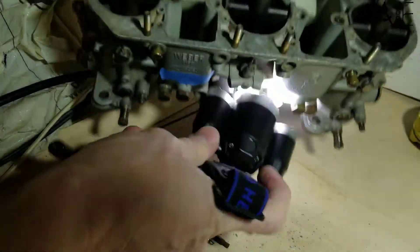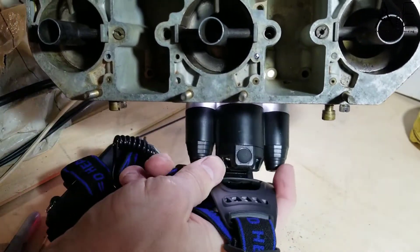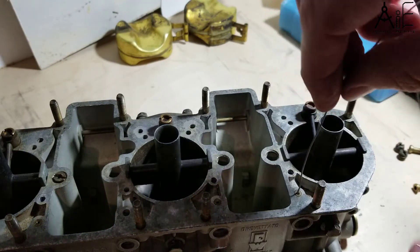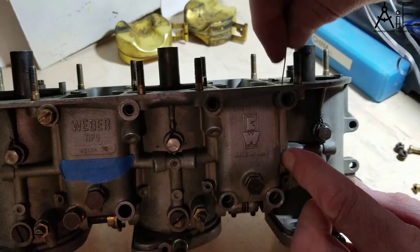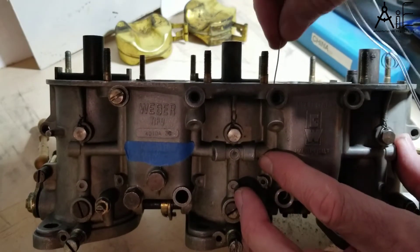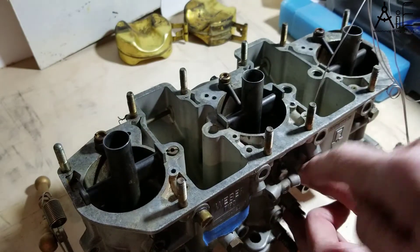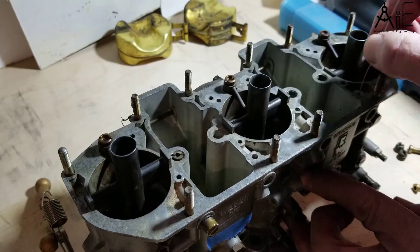Here's the light test — you can see the light in there. One more tip for cleaning these things out: there's a little air correction right here, and you can check if your passageway is clear down to here by just pushing a wire through. Chances are a lot lower that one's going to be clogged than those ones down below the float bowl. But you can check each of these by just shoving the wire through. If it is clogged, you're going to need to take out one of these plugs and do the same thing — drill through here so it connects up, and you might have to take those out, but hopefully you don't.